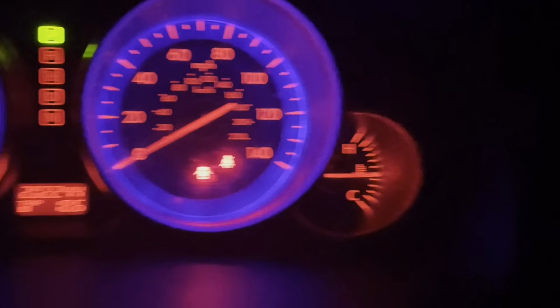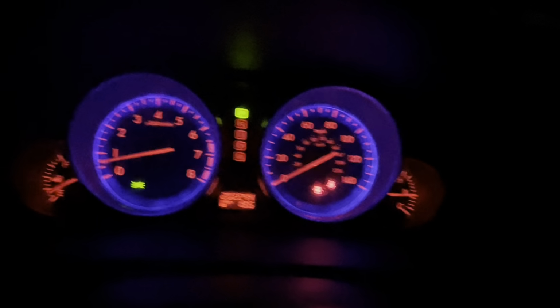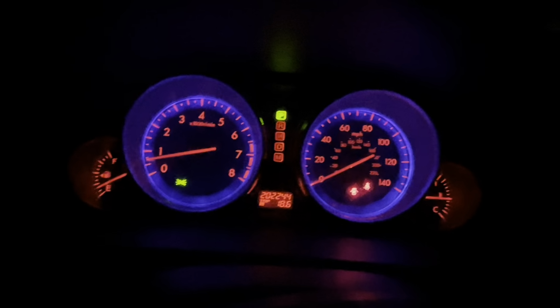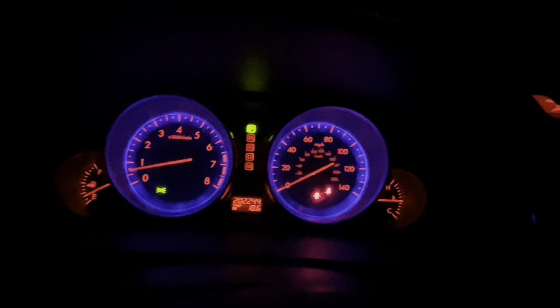We are definitely warm. Again, that door ajar light, we're thinking is because of the BCM body control module. I pulled the tool out of the junkyard. Gonna continue throwing the switch, but I have had these gauges flicker up and down and my vehicle wouldn't start where I had to mess with stuff. If it does that again, I'm changing the body control module.